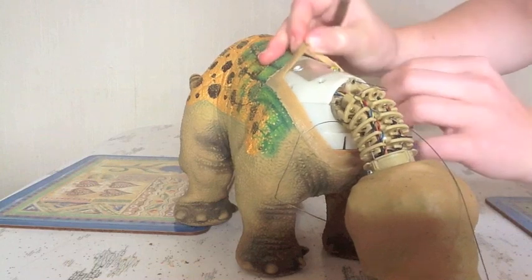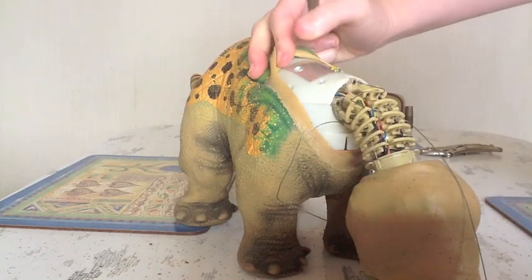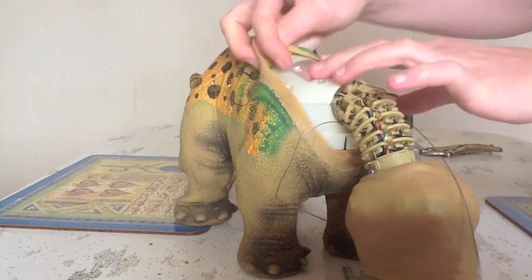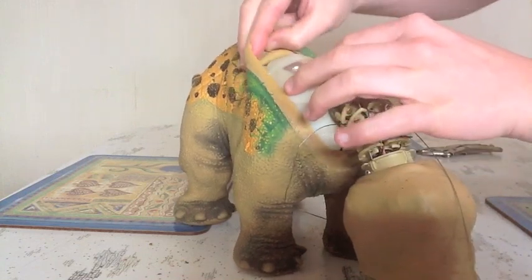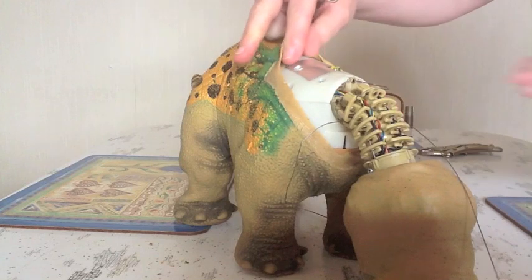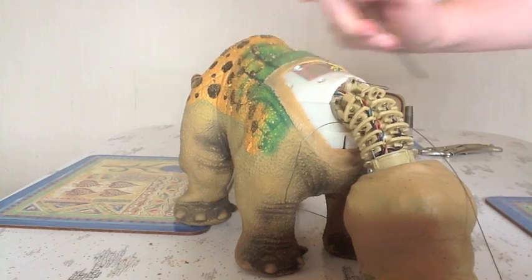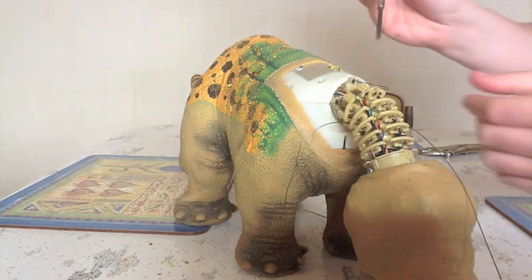Okay, the next thing to do is to remove this white plate. Now there is one screw underneath this silver plate here that you won't be able to see. So you need to either peel the foil back a little bit, very carefully, or just make a small hole in the foil. I've opted for the hole method. It doesn't seem to affect her sense of touch at all. And well, I tried peeling back the foil, but on mine it just started to tear. So that'll depend on your Pleo and again how much glue is there.